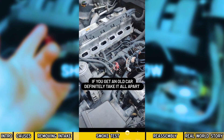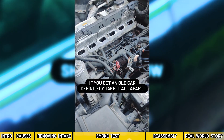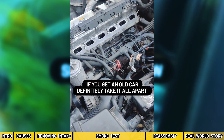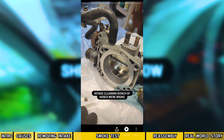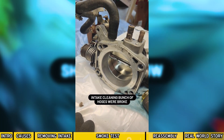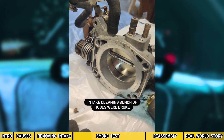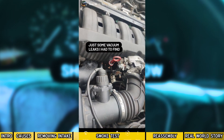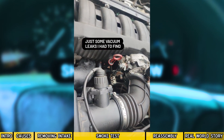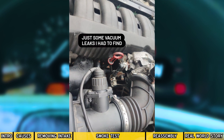I've got a little story time for something that happened about a week later when I did another smoke test. But if you're still here, you might as well just like and subscribe. Pretty much a week after I took this video, I removed the entire intake system. As I took it apart, I noticed that there was one hose kind of disconnected — it was the hose that comes from the idle control valve. I didn't think much of it. I cleaned the entire intake system, the whole manifold and the whole elbow and throttle body. Then while I was putting it back together, I heard another vacuum leak and my car was still acting exactly the same. So I performed another smoke test blowing right into the mass airflow sensor. As it filled with smoke, I noticed smoke shooting out of an open hose that I just forgot to connect back on. As soon as I connected that hose back on, the car ran perfectly.